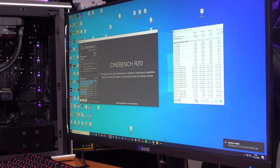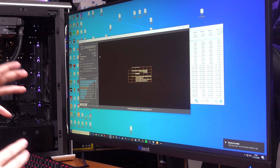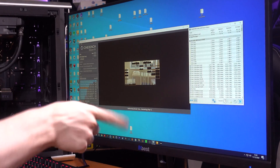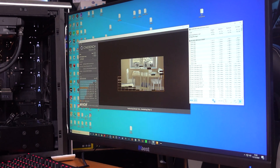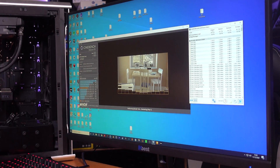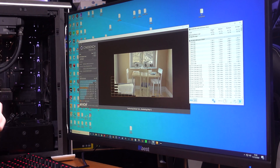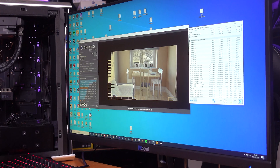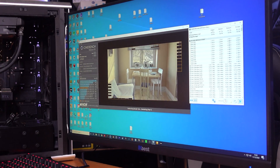We're up and running in Windows and I'm running Cinebench R20 in the background so you can see it working and see the clock speeds, which are all boosting. Right now it's 4.3 gigahertz pretty much all-core on the 5900X. Boost works fine and even the single-threaded boosts are working fine as well. I can see that one of the cores was at 4.95 gigahertz at one point during single-thread boost. So you can see the X470 works just fine - let's test out that B450 board.